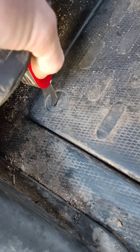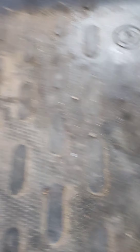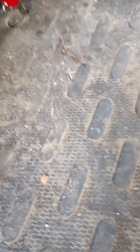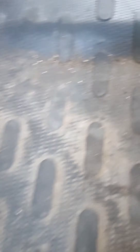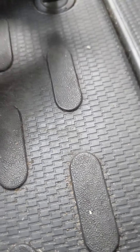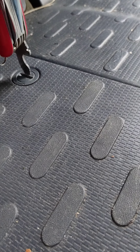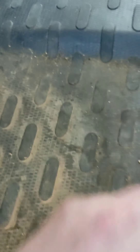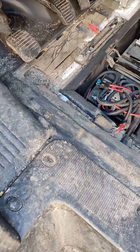That got me going, and that was fine. But from my experience, I realised the van is six years old, and there's every chance the battery may have been on from new. Really cold weather is usually when the battery starts to fail and shows signs it's getting weak. So I ordered a new one from Battery Set, which I think is a French site. It was €127 delivered for a Varta Silver Dynamic — the biggest one you can get.